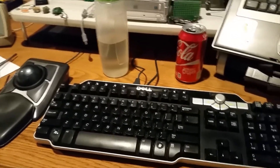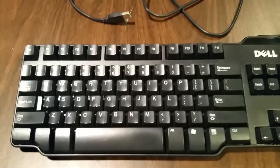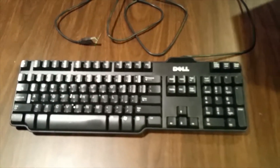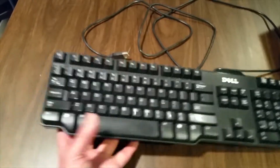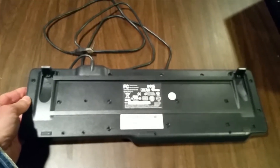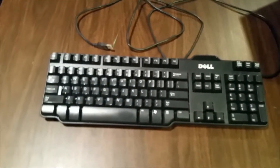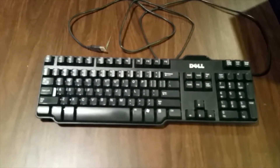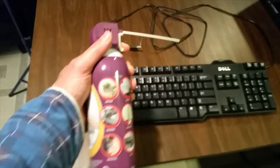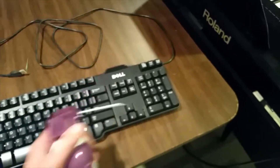Let's start with basic keyboard cleaning. The best time to clean your keyboard is when it's disconnected or before you boot your computer. The first step is to turn your keyboard over and knock the chunks out. Not that anybody would ever have chunks in their keyboard, but sometimes people eat at their computers and stuff can get down in there. A simple tap loosens up most of the debris. Canned air can also be used to remove loose particles and dust from the surface of the keyboard.